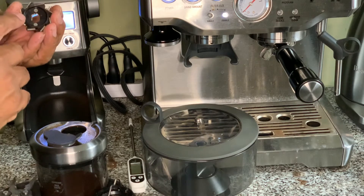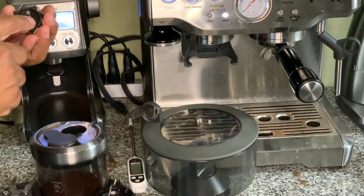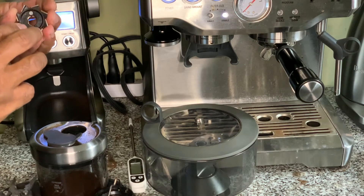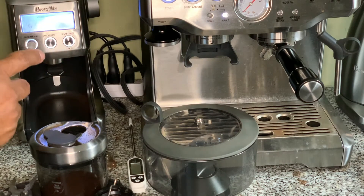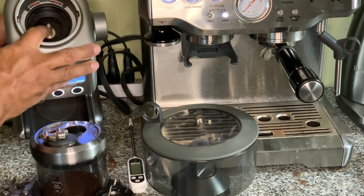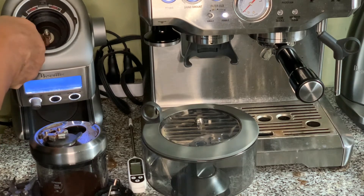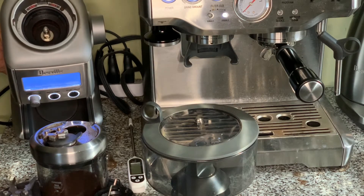One of the problems is there is a felt piece that goes under here — it's a little ring with a round hole in the center. You put the felt in there and slide it over the impeller shaft. There's a key that fits into the shape on the top of the impeller, and then you put your burr set on top of that, screw it down, and it's supposed to be locked down. There is also another small washer in there that, when you turn this upside down, falls out.